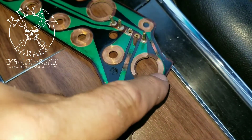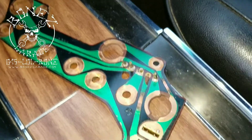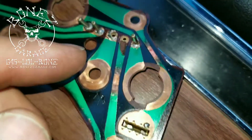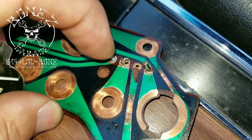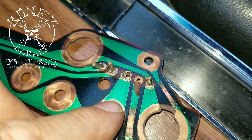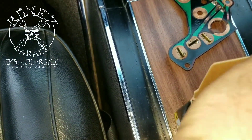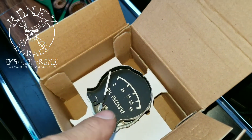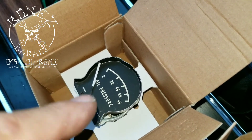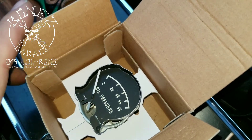Then you have your ground for these three terminals and your ground for your lights — so this would be a light, that would be a light, and that would be a light. That's how the printed circuit board works. You can see it fried at some point in its life — right there and right there — plus the terminals are all loose. These two had already broken off, and that is the reason the gauge wasn't working. Remember: these are only 5 volts — if you put 12 volts to this you will instantly burn them out, let all the smoke out, and electronics don't work without the smoke. Little tip! Alright, you guys have fun, talk to you soon!